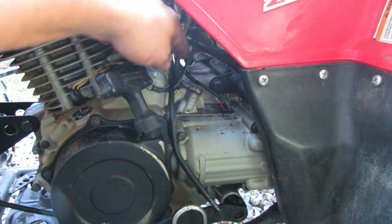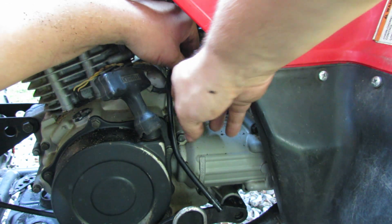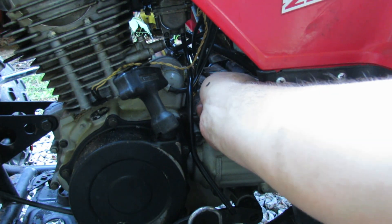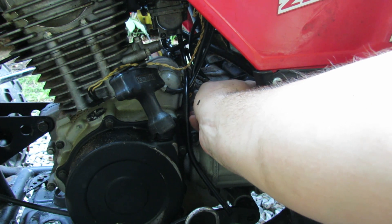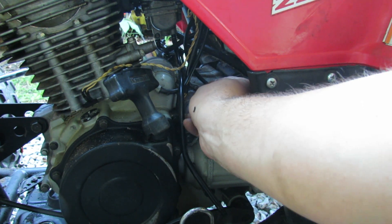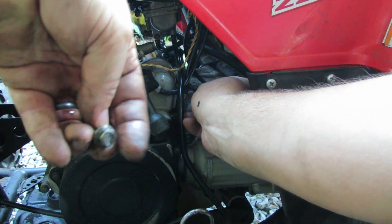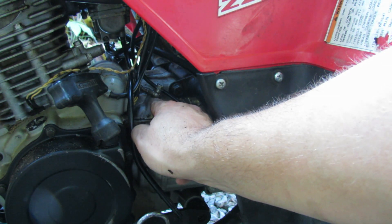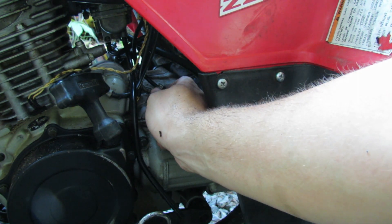Put your first washer in underneath, so that goes there. Put your line down on top of that washer, then take your bolt with the other washer and slide it down through the center. Make sure you still have that other washer underneath of there — the cameraman can get in a little closer. So we've got the washer, the oil line, the other washer, and the bolt.